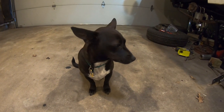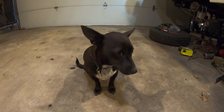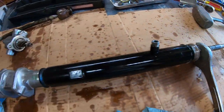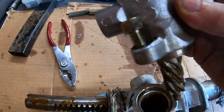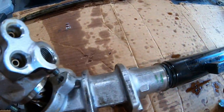I get the rack working really good so keep watching. Note to self: always take the outer tie rods off first, because once you take the pinion out you can't take the tie rods off and get this back in — it's really hard. I even took out all the jam nuts and everything.